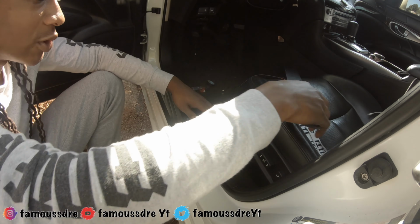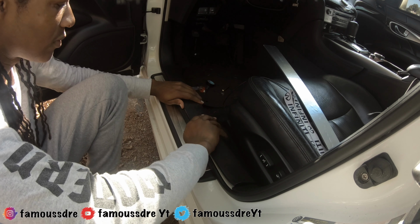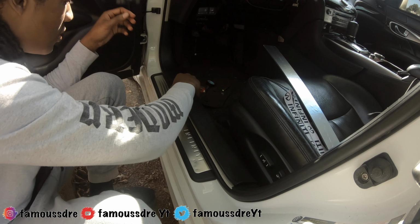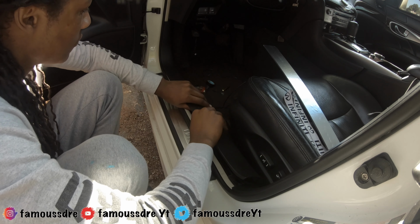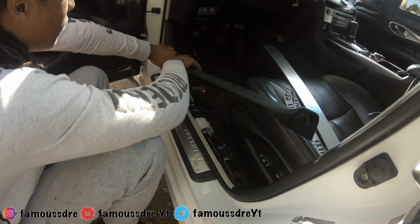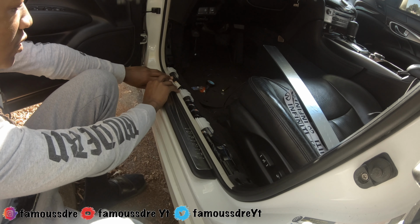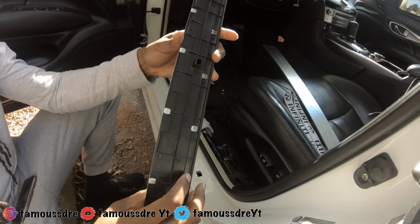So, first thing you wanna do is go ahead and pop this off. I don't got no special tools to pop them off. I just use my hand, you know, try to just work it. Try not to break it. Get that out the way. Next, you can pop your door sill off. Mine just held on with clips. Some people's is held on with like sticky tape, but mine just got these clips on it. One right there, one right there, one right there, and one right there.